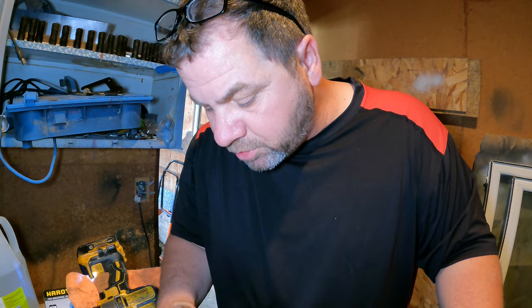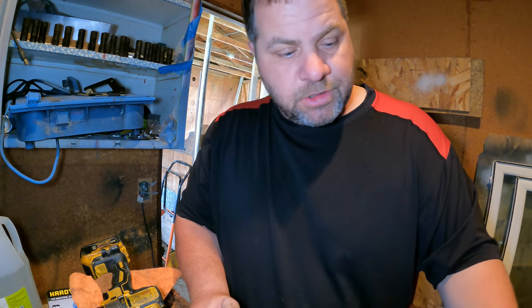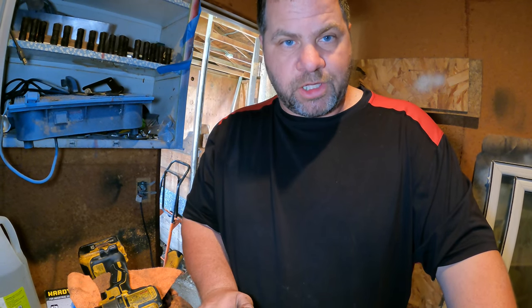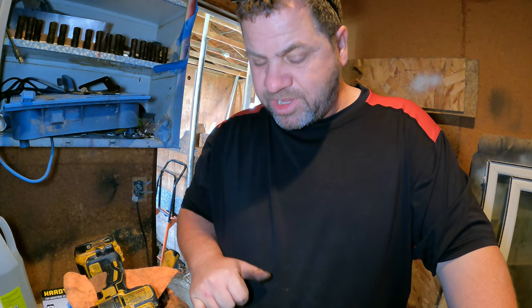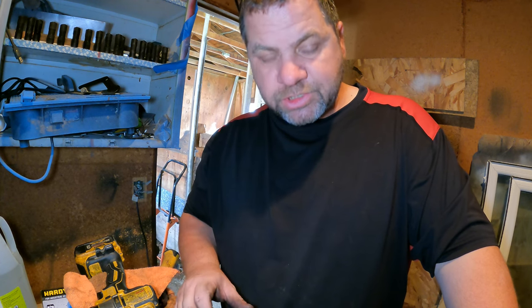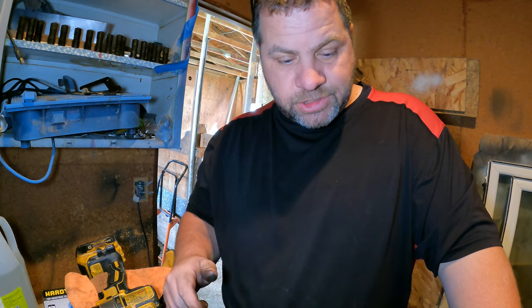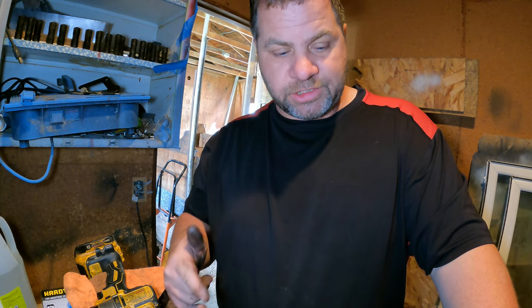I got the most important one out that I needed to get out, causing no further damage. I've gotten this one manifold bolt out without causing any further damage. This one is going to be a problem, and I'm hesitant to try and do it on the other head because I just think I'm going to run into the same issue. So I either need to find somebody that can weld me a couple nuts or buy a welder. So we'll see, but I think in the meantime, I'm just gonna go ahead and get this head cleaned up.